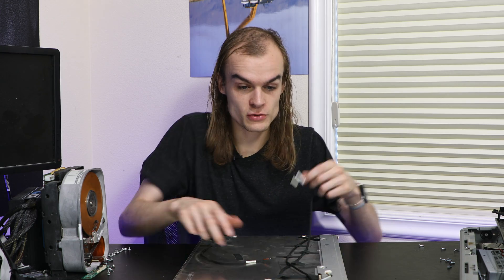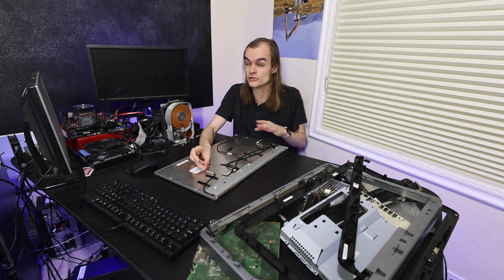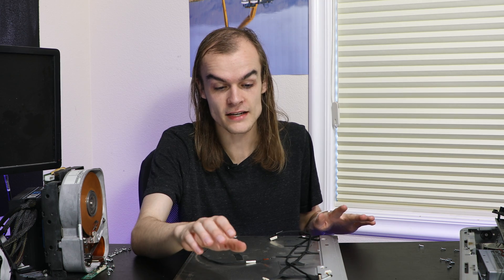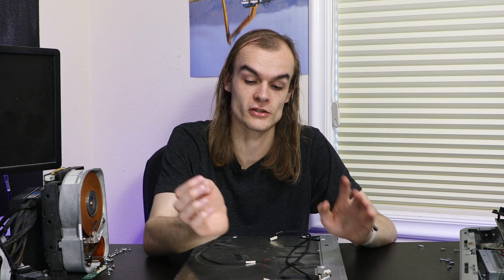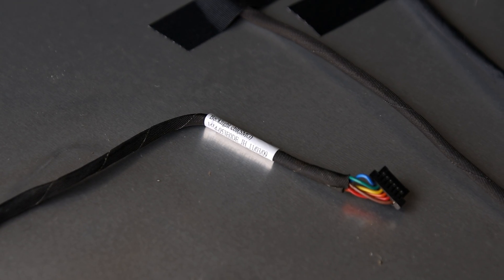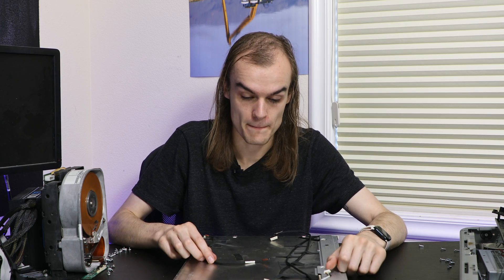Taking a look at my board, I actually see two touchscreen connectors. Not a lot of systems have touchscreens, and I don't find a touchscreen on a desktop monitor useful, so I'm going to remove that. The next connector is this big one — it has all the display signals and is LVDS, marked as LVDS on the chassis too. I believe this is a 30-pin standard. Unfortunately there are a lot of different pinouts and sizes for these connectors, so even though your board says LVDS it's not always the same. The next connector is on the other edge and that's for the backlight — a little strip of LEDs that light up the back of the screen. You're going to have to make sure that these connectors match whatever driver board you find on eBay.